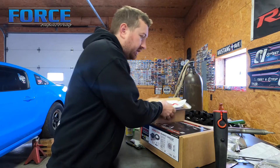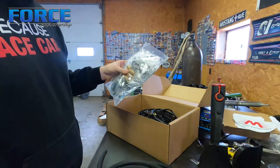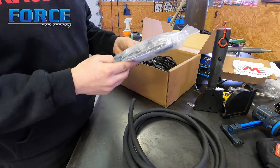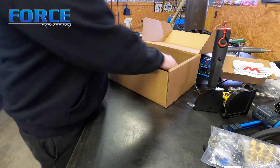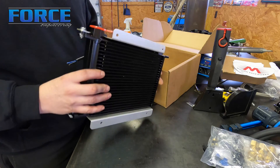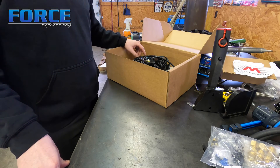The next video will cover the trans cooler. I got a Derale unit — it comes with rubber hose and push-lock fittings, but I'm not going to use those. I'll use Pro-lite 350 hose instead. It's a nice cooler with a fan and shroud. I'm hoping to mount it in the back of the car. The next video will cover mounting and plumbing the cooler, and hopefully installing the drive shaft as well.